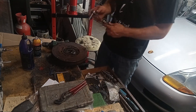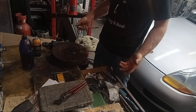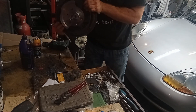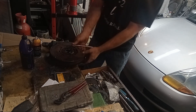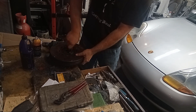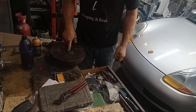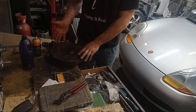I feel like this is best explained in video format because it took me a while to figure it out myself. The two are one. That is a Mazda counterweight, a Porsche flywheel. The two are one now. The pilot bearing for the Porsche is inside the flywheel, so I can align that with the adapter that I made.